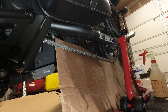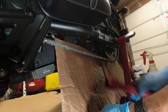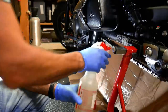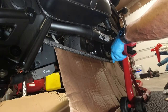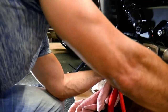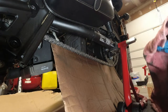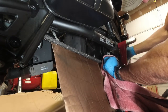Make sure the bike is in neutral so you can spin the wheel. This is a reason why a stand is great — you can stand the bike up, put it in neutral, and spin the wheel. Otherwise, imagine trying to do this in your driveway, spraying a little at a time and rolling the bike — that would be annoying. Also, as tempting as it may be, you never want to do this with the bike running and in gear. I've heard of stories of people doing that — getting your hands caught in there is a world of trouble.